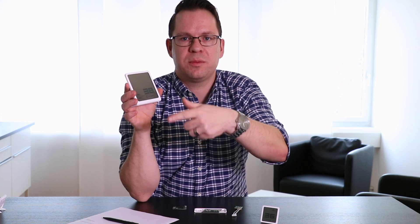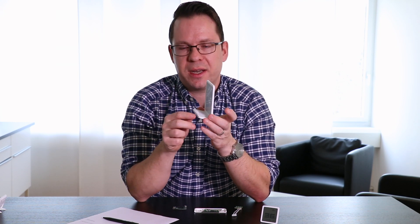Now let me move to the next important point: where to place your hygrometer in your apartment or your house. Please do not put it in a tight shelf where there is no air circulation possible. The sensor back here needs some air circulation — otherwise the humidity reading will be faulty.